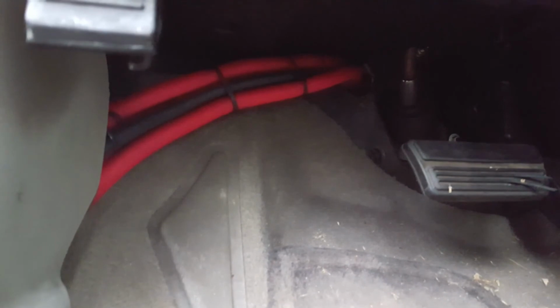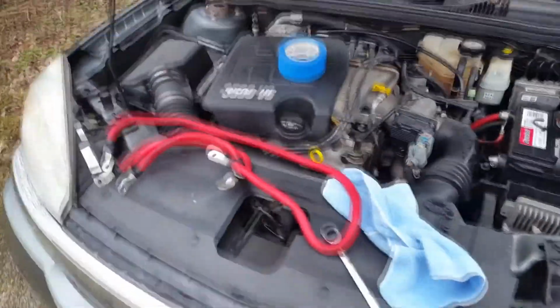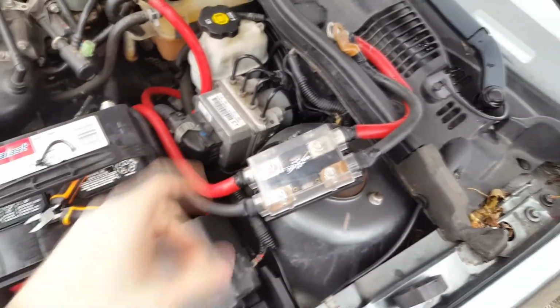Then that's where we'll start pulling the wire through right there. And I believe it's all ready to pull through. We can take this out. This was the piece that was for our alternator to the battery. Yep, and then this is all from the amp right here. This is my three runs of zero right there. So we could get this one through. But first, let's take this cover off, unbolt these two so we can pull those through.